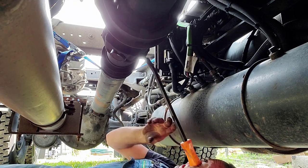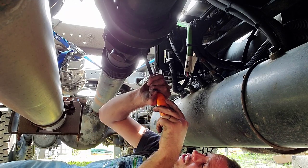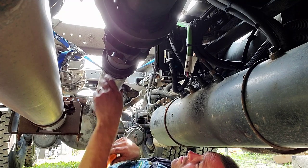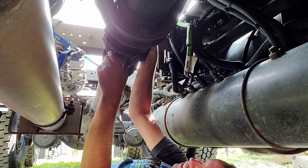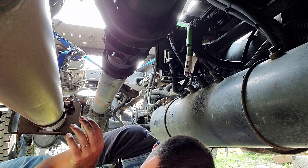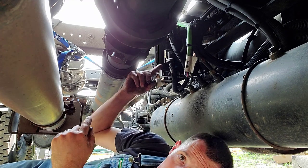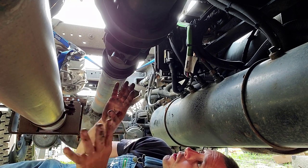And if you guys follow me, you know I just redid both U-joints on this drive shaft, so if you're interested in that, look at our older videos from about a year ago and you can see that as well. There, and those caps are pretty tight on there, so I'm not too worried. Later on I might take some electrical tape or something and wrap it around those caps just so they don't fall off and lose all the needle bearings.